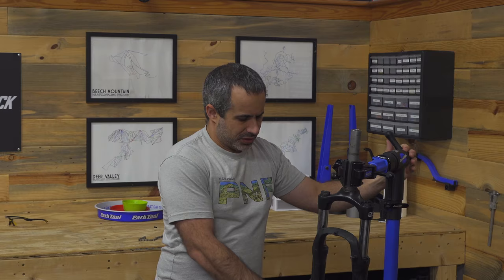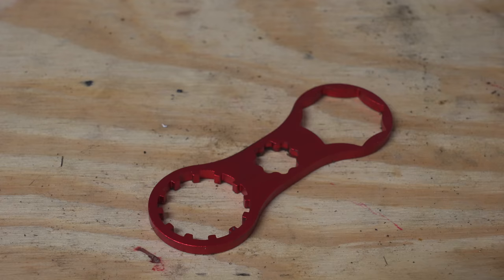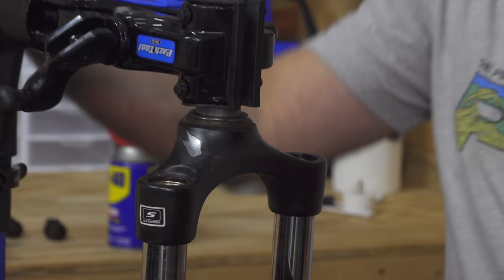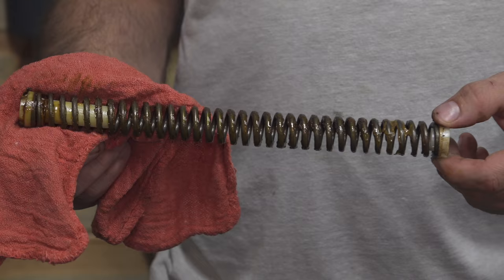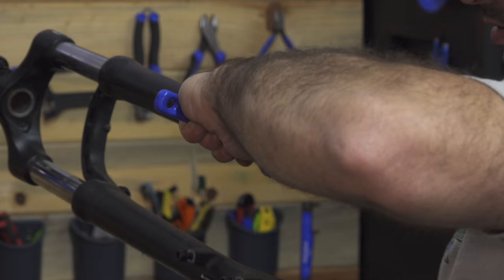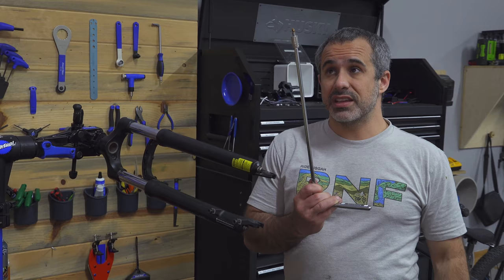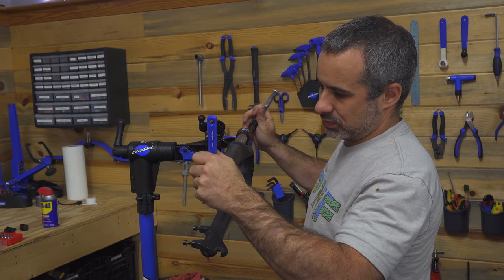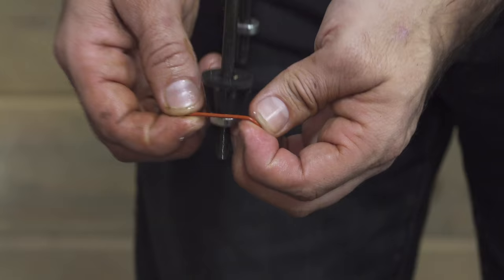First things first, you want to take all the stickers off — that might take a little bit of time. You're going to need a special tool, I left a link in the description, just a few bucks, so you can remove the caps on the top of your fork. Then flip it upside down and the springs are going to come out. They're going to be really dirty. If you clean these up and re-grease them, it'll actually make the fork run a little bit better. This fork has seen hell. Loosen the two bolts on the bottom, then you're going to need a 300mm socket extension with a five millimeter hex on the end. Pull the lowers right off, and now we can take our little red o-ring and put it up on there just like a high-end fork.